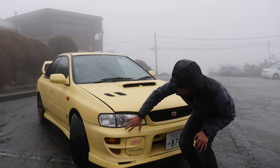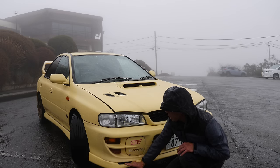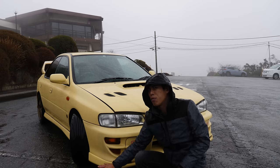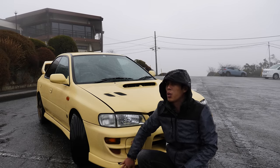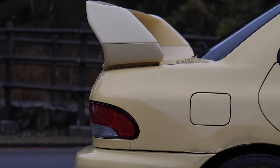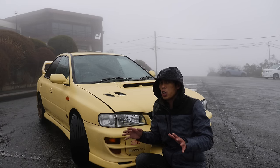The version 5 onwards was the facelift version, and it had a different design of the canards, well, for better airflow. And the version 6 had something very different from the version 5. It's this lower spoiler. It's deeper down here. Otherwise, nothing much has actually changed from the version 5. And also on the rear wing, the angle of attack of the rear spoiler is a little bit higher. So these are the two distinctive features of the version 6.